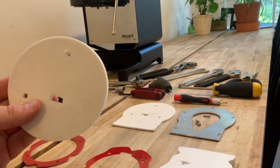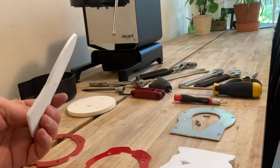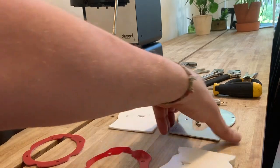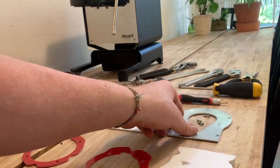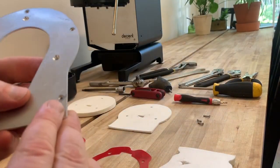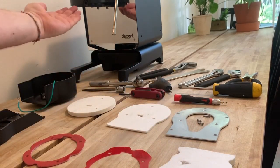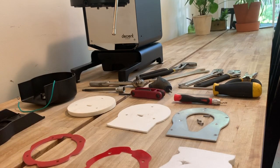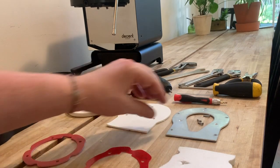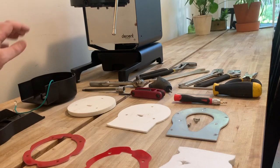This next piece is just a layer of insulation — the first layer above the PCB board. This is the second layer of insulation, much thinner, above the PCB board. Then this is the retaining plate that holds the insulation but also acts as the mounting plate for the GHC. There are threaded holes and the bolts will come up from the bottom. These three screws are what mount the mounting plate to the GHC and cover assembly.